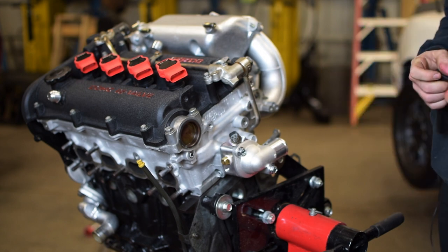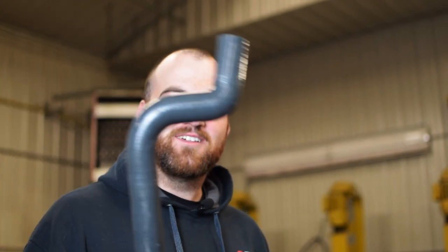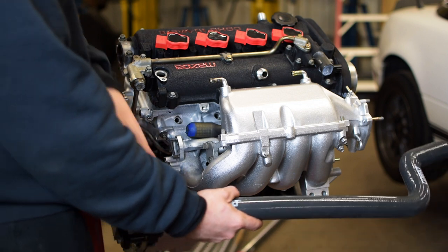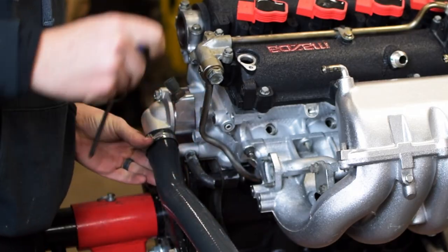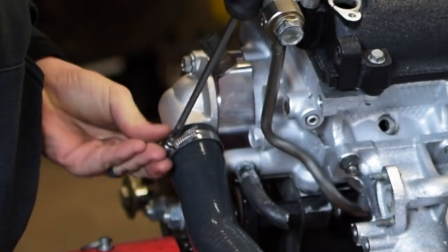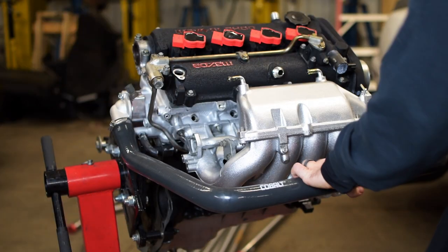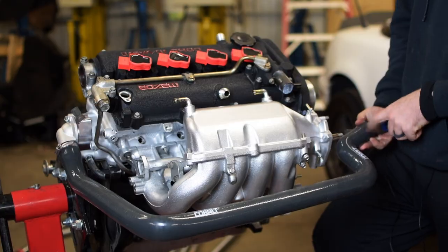That's 90% of the install. Up next is installing the coolant hose. This is a nice preformed piece — when I did the case swap, I had to hunt around for different parts and hoses that would fit. This is a beautiful off-the-shelf option; it's pre-bent, you don't have to kink anything. When you install it, the long end goes on the back of the block so it can reach around everything else. If you're doing this out of the car, make sure you screw it down at an angle you can get to in the car. Then it will run around to the front and tap into the factory radiator really nicely.